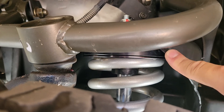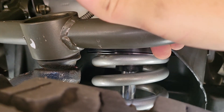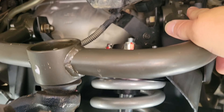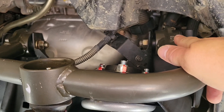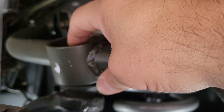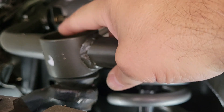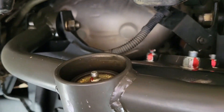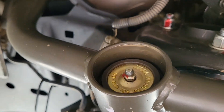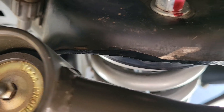With the Freedom Off-Roads I had to shave the coil bucket. But with the All Dog Off-Roads — I got these for four hundred and eighty-nine dollars — they press in the bushings, so all I had to do was have them installed, they're ready to go. They've got Zerk fittings on top and all you have to do is maintain them by greasing those Zerk fittings.